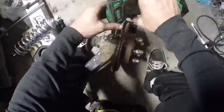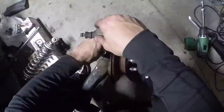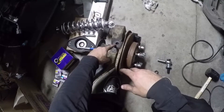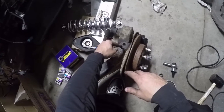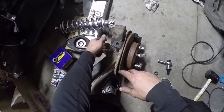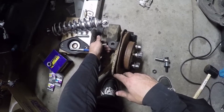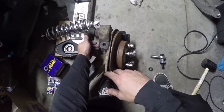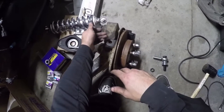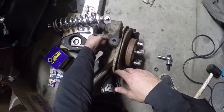So let me explain a little bit about what I've done here. I basically had to bore this out — part of it we had to bore to 5/8 inch to fit our bolts for mounting, but part of it is a tapered bolt originally from the factory, so basically part of it was just bigger than 5/8, probably like 11/16 or something. By boring it out to 5/8 inch it kind of let us get the most consistent and a lot of contact area.